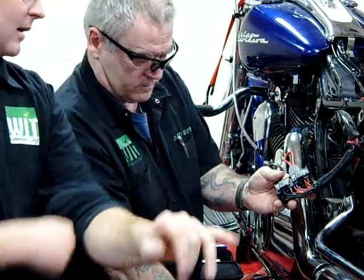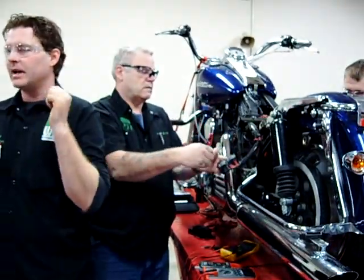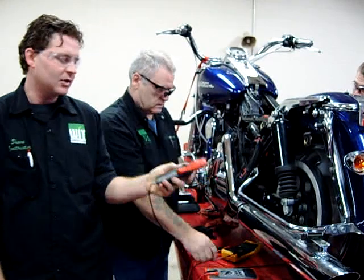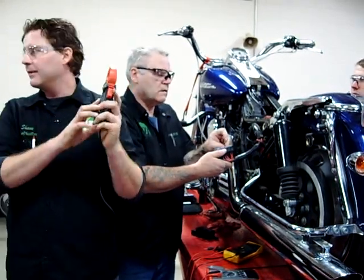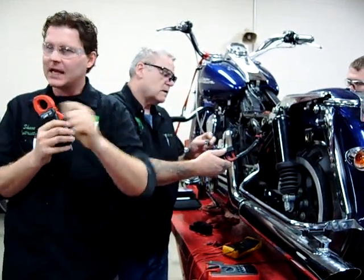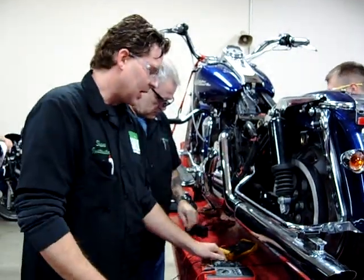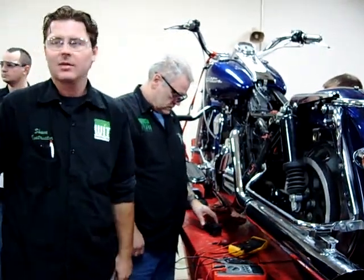The point of this demo is to show how quickly and easily we can get current measurements without having to disconnect anything — just pull a fuse. Pretty cool tool. Where would you get into trouble using this? Having it on the wrong scale, or forgetting to zero it. Every time we used it, we went and re-zeroed it. Meters in series, checking current draws where they're supposed to be — that's how you do it.